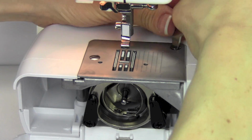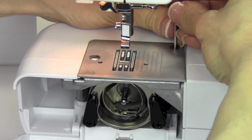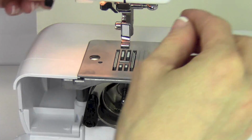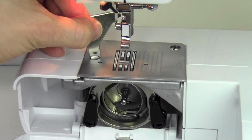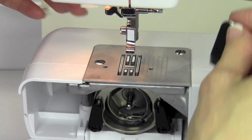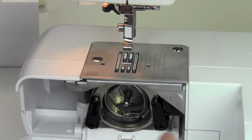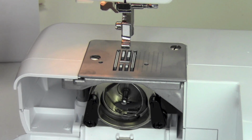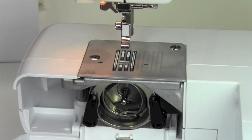So I always change the needle first and then keep sewing. And then if I have further issues right away, I'll stop and make sure I've cleaned the machine. And sometimes that's a lot sooner than 3 bobbins. So don't fight with the machine. The machine will work just fine as long as you put good quality thread on and keep the needles properly changed for the right fabric you're working on.